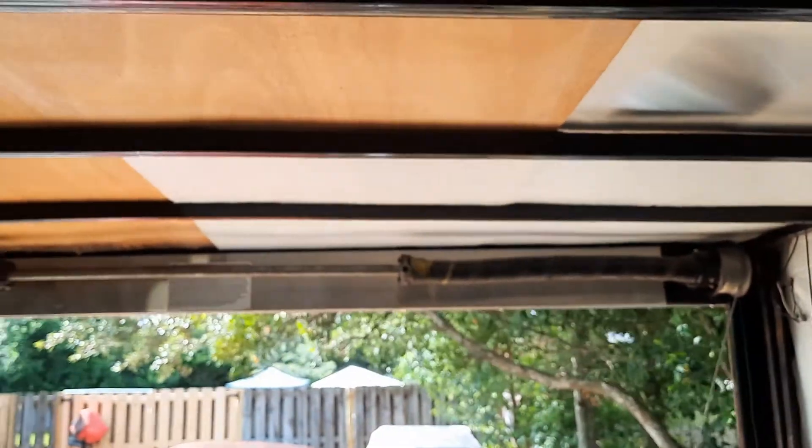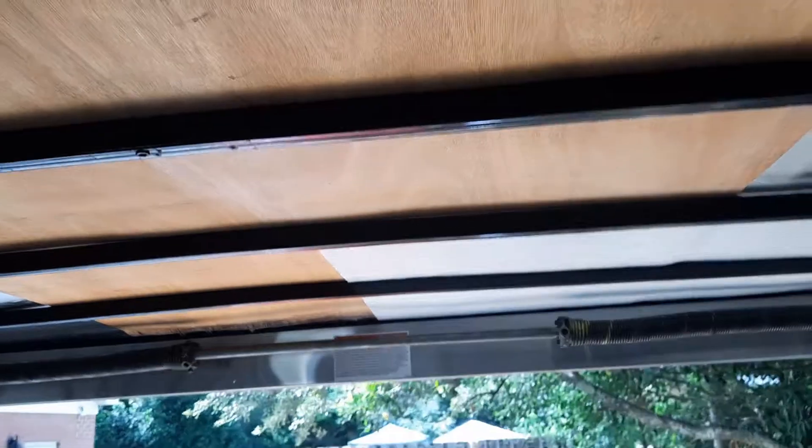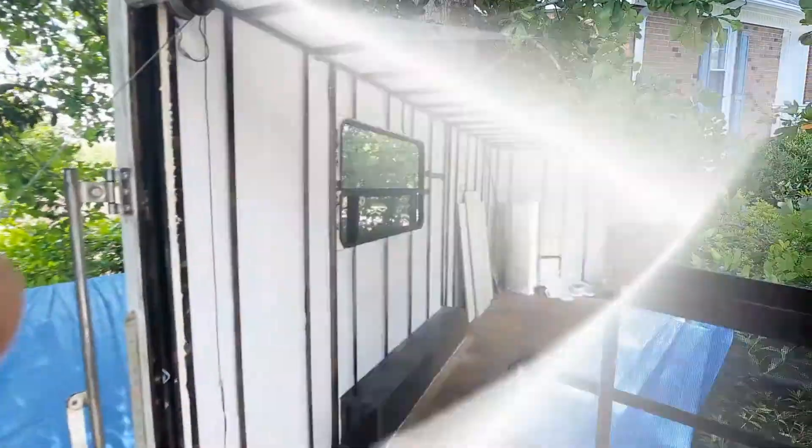The trailer's getting wider. Both sides are pretty much in — the other side is done. Now I'm starting to work on the ceiling. The good thing is I'll be able to put one inch here and three-quarter inch on the sides of the foam, which will help the roof a lot. It'll take me probably three or four more cans of adhesive. Then I'm going to put an aluminum inch-and-a-half by an eighth-inch flat bar down through the center. On one side I'll have beadboard going this way and I'll need something in the center to screw it to. Hopefully by this weekend I'll start putting up the foam.